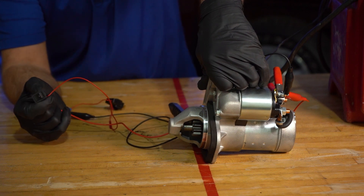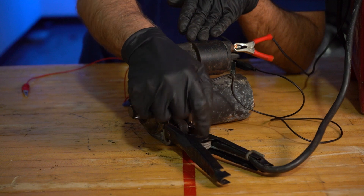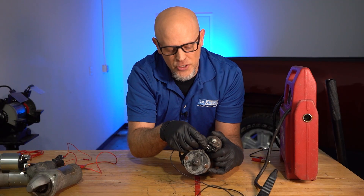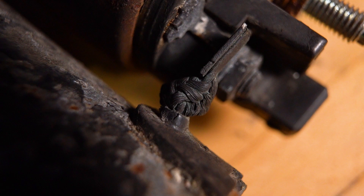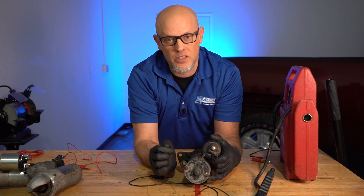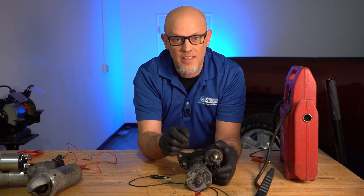So these both failed in different ways — let's test these out and show you how they failed. I have another jumper wire going from the ground to where it attaches to the solenoid. With that added jumper wire, that's actually bypassing this little braided section of wire that grounds the body of the starter to the solenoid. As you can see, it has failed — it is green and it's about to break completely. When we were trying to get this vehicle to start, it was extremely hard; we had to use two jump packs and even then the vehicle would crank very slowly. It happens to be that little ground right there. Eventually this ground will break and the starter's not gonna engage at all. So if you have a slow cranking vehicle, this could be your issue.